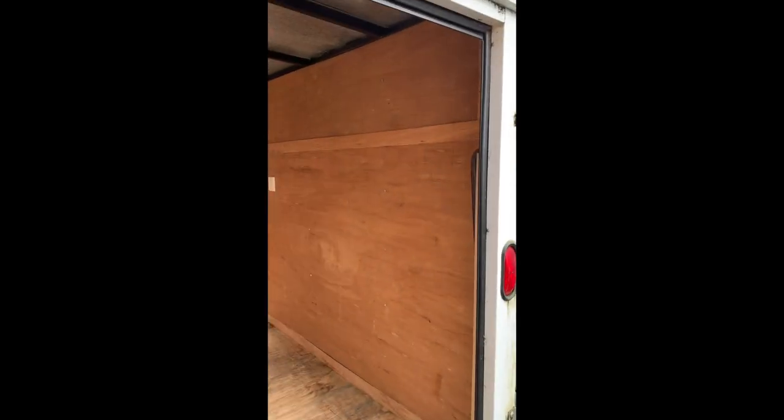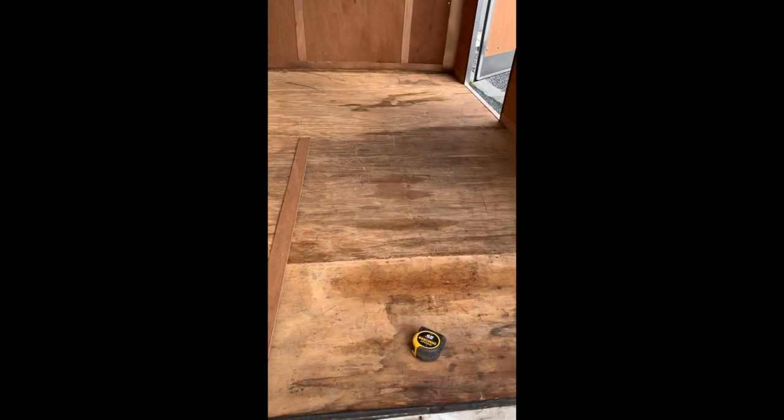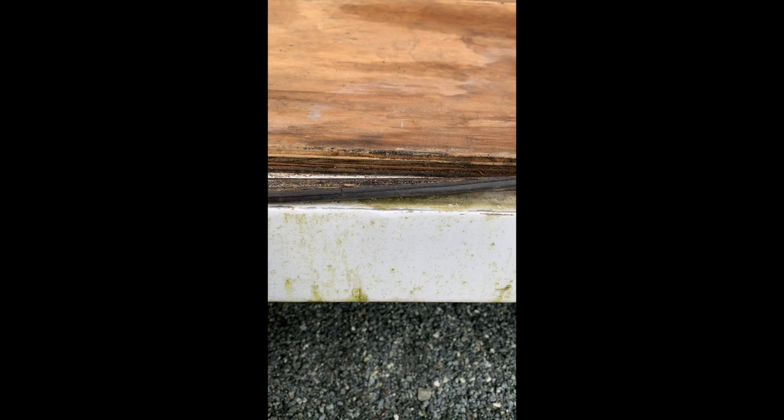So here's what we're doing. First step — this is just like door skin on the side here, and I'm going to be making custom shelves. If this thing is being towed down the road every day, that's just going to fail. So we're going to put half-inch plywood all around it. The floor here actually looks like standard 5/8" plywood, and it's just screwed into each cross member.